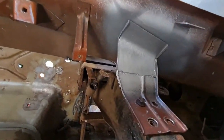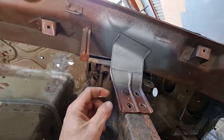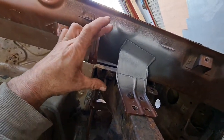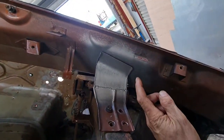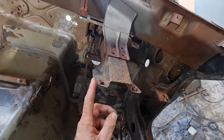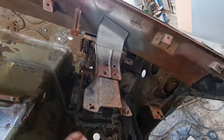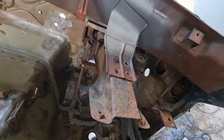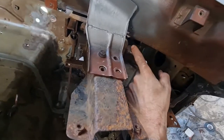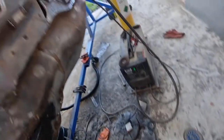I've folded this bit of steel here. This is only a middle plate but it's under tension so there's no real need to go up to the 1.5mm. This is clamped up and I'll weld the seam here and across the top — that's just going to sandwich it out there nice and tight. When I was doing my mock-up measurement I found I need to go up slightly to the right, so I'll give it a little squeeze over and up and that should have it spot on. Then I can go and fabricate the mounts for these on either side, but I will need to fill in the void I created.